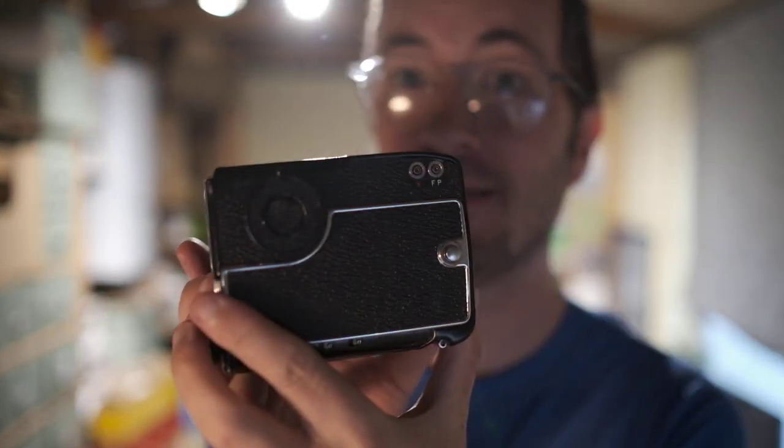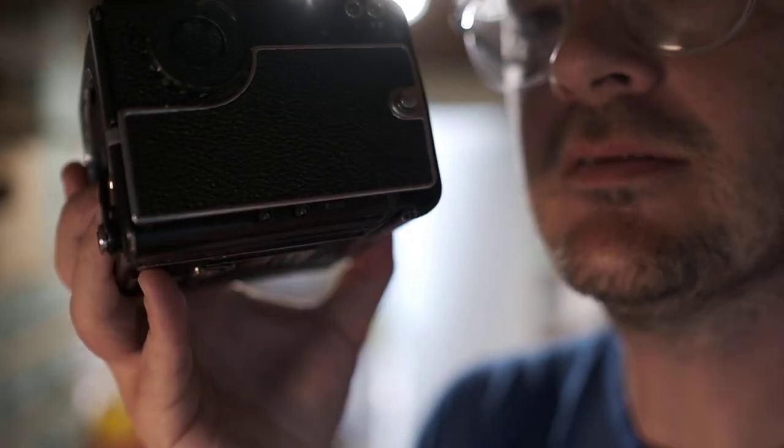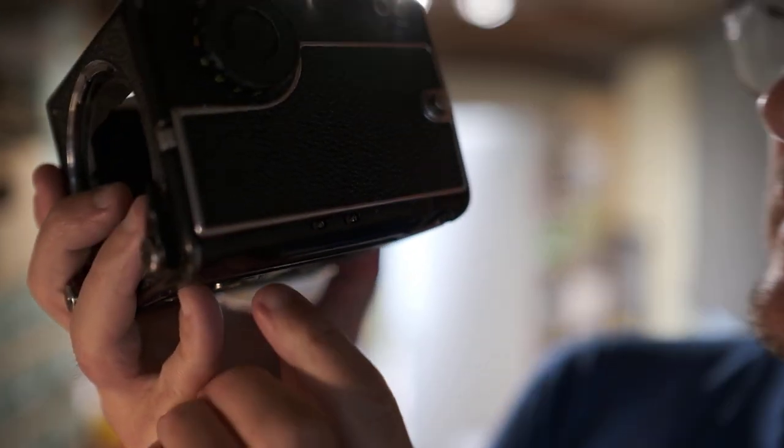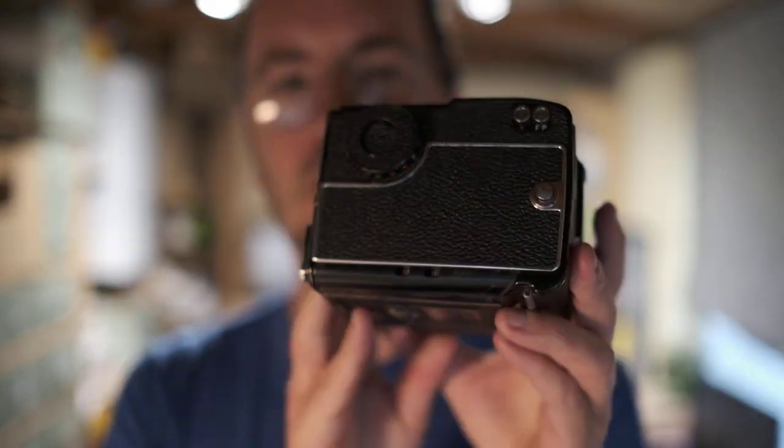What I found was the key thing: I got around to the other side and just in here — can you see that? — there are two tiny little screws. If you take off the little panel there, you'll see there are two tiny screws. They are the adjuster screws for the front and rear curtains.